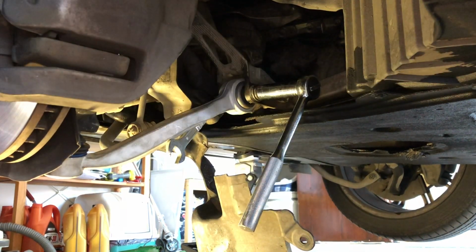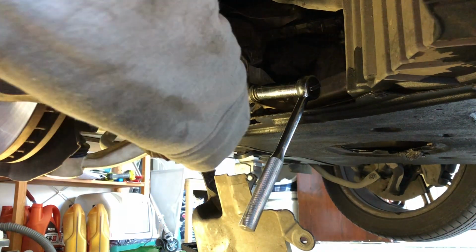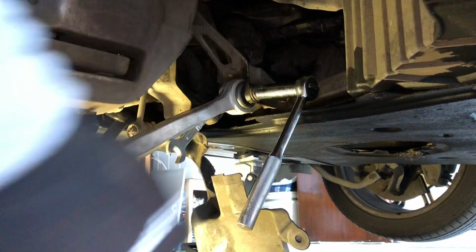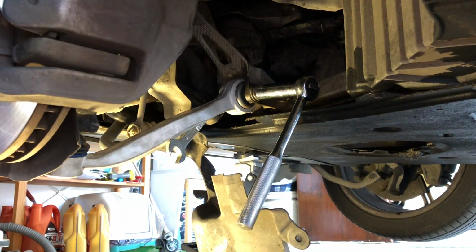Because suspension, as I said, this wheel's just moving constantly, carrying on. So that's the torque spec, BT. Same down here on the ball joint. Do it up really, really firm because this is suspension, and yeah, it's serious. And for those of you that have got a torque wrench and are going to be doing up to a specific torque, then find the BT setting and adjust it up to that.